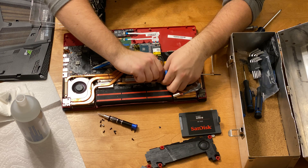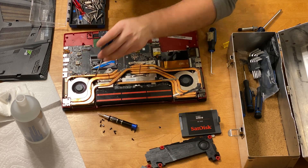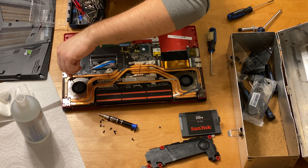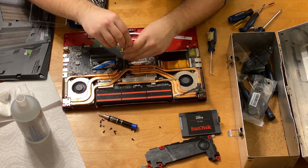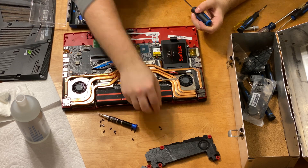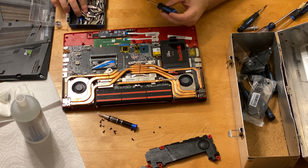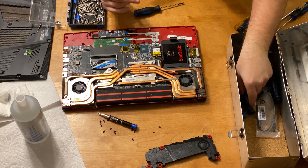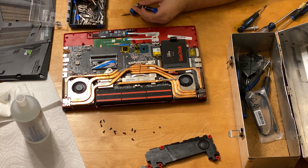I ended up figuring out that if I put the wire underneath the pipe and squished it down just like it came from the factory, it would avoid contact with the metal piping which gets warm. For the triangular screw pattern I evenly distributed the pressure — screwing each down almost all the way and then coming back to fasten them a little tighter. For the square chip I went in an X pattern to make sure the thermal paste was evenly distributed. I added a little bit extra but it didn't come out the sides, and it wasn't so messy that it would obstruct airflow or any connections.